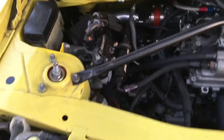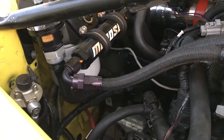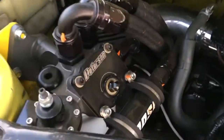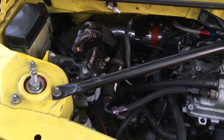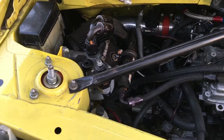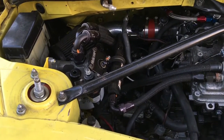The first thing you can see here is the Peterson oil filter mount — it takes a much larger oil filter than factory. Another cool thing is it's got that little pump drive on the front, so you can put an electric drill on that nub and actually pressurize the engine with about 25 pounds of oil pressure before starting. Really great way to prevent startup wear. And if you couple that to a tank heater for the dry sump tank, you can actually use warm oil, which is pretty cool.